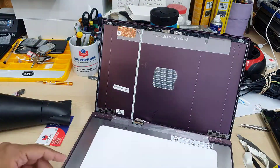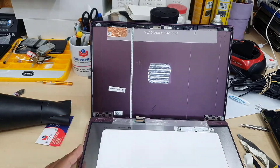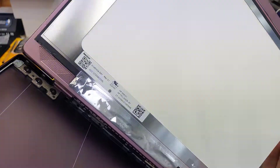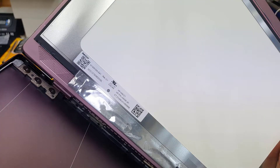This part is very important because you're going to handle the 30-pin, very sensitive LCD connector to remove, which is attached with strong adhesive. You can find the right HP part number and model number here. You can use this model number to order the right replacement. Once you have the right tool and the right replacement, you're good to go and you can disconnect the 30-pin connector.